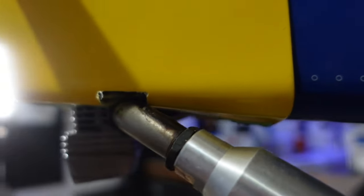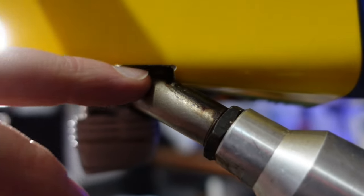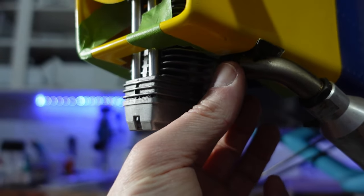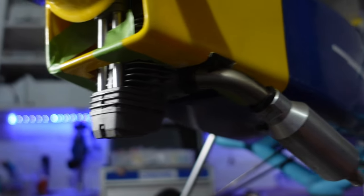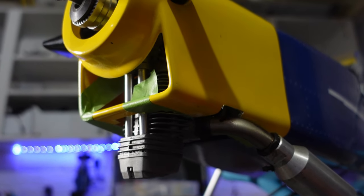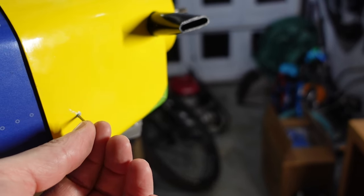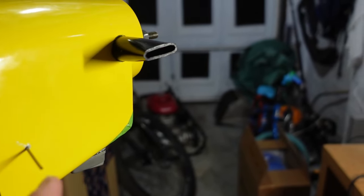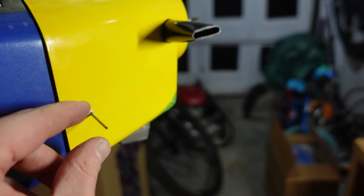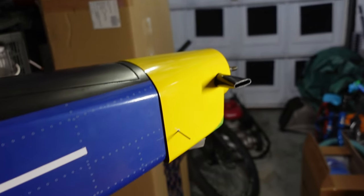At the front I've only cut out just enough for the pushrod outers to give them clearance. The great news is the exhaust didn't need a hole cutting in the side of the cowl — it's pretty much at the bottom — but I did have to cut a small slot there otherwise I couldn't get the exhaust in as it was fouling with the edge. That little slot looks quite neat and it means I can get to the nut to really tighten the exhaust, which is renowned for coming loose.